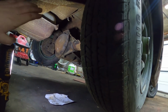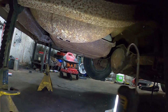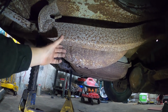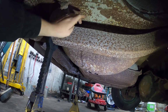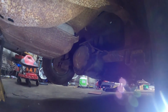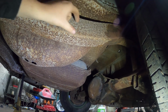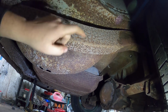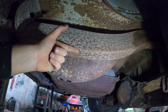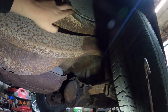What I wanted to do is they sell a kit which relocates the spring, because typically it runs on the outside of the frame, as you can see, and it actually moves it to the center of the frame. So there's a piece that goes on top, so the spring actually sits between the trunk floor and the frame. And then you hollow out the front of the frame where it would sweep up, you box it, and you run the spring in there. So it brings the spring in, so you get a full spring length width, which I think is 2.25, 2.5 inches on these Tri-5s, worth of more tire, so you can then tub it or do whatever you've got to do.